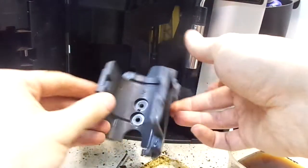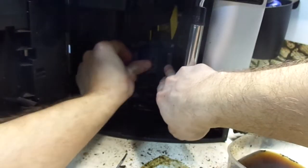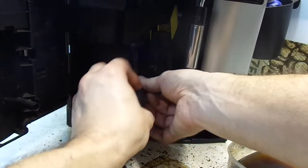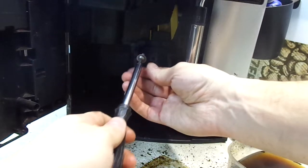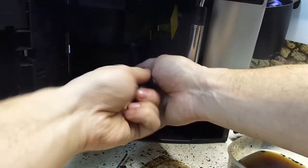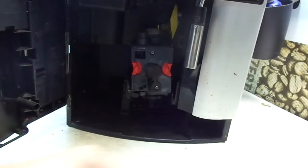You know how to replace this O-ring — put lubricant on it first, then I will replace it. Now here is the support going back in. Return the screws to secure it. This maintenance will prevent a lot of problems with your coffee machine. We have the clean brew group installed and now we're going to clean a little more around here.